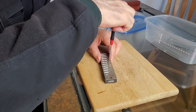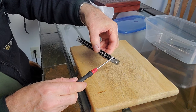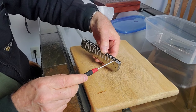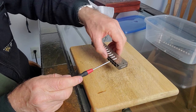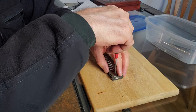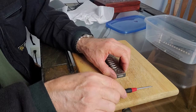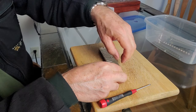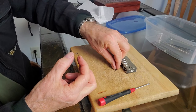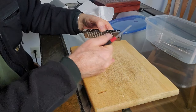Be aware there is a spring on this side — that's the slide spring — and a little screw kind of holds it in place. When these reed plates come loose and the screws are out, that little spring might try to get away. So go ahead and remove that spring now: unscrew it, put your thumb there so the spring cannot escape. Those little springs can jump away and be very problematic.